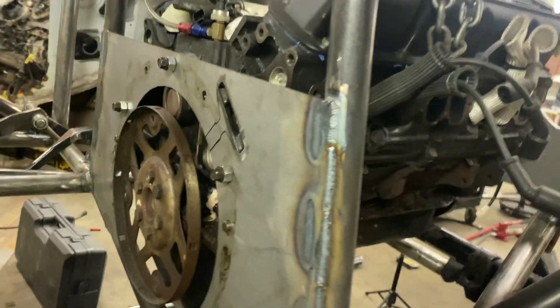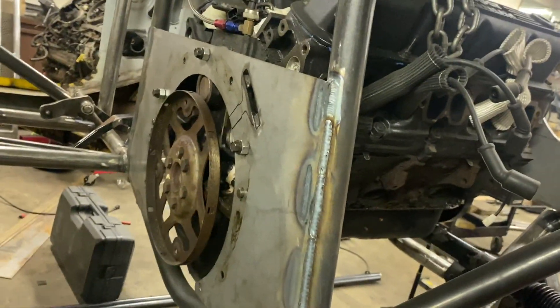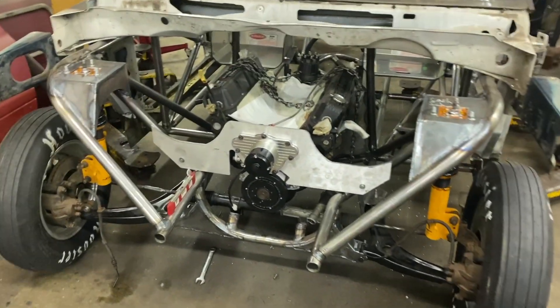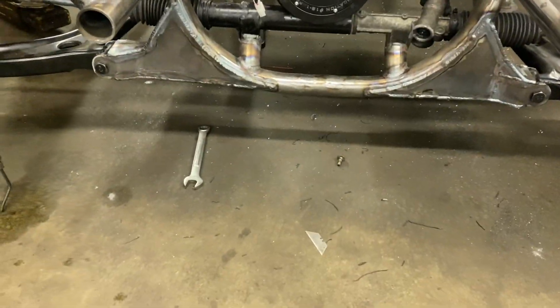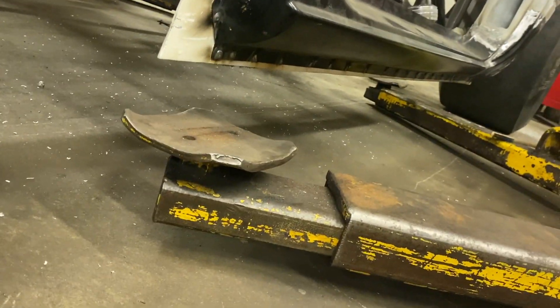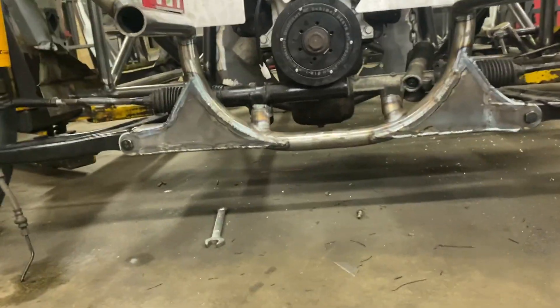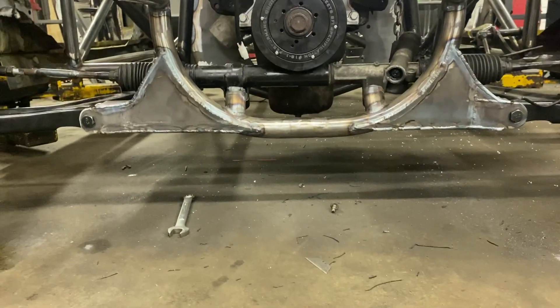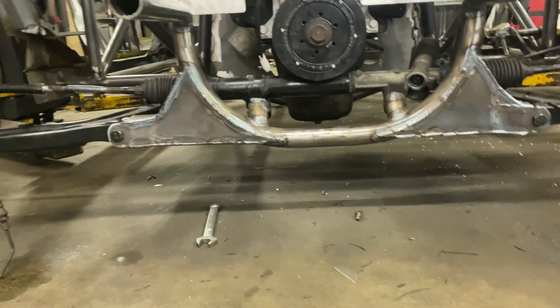You can see how the motor is sandwiched between the motor plate that's permanently attached to the truck. We also have a cutout for our crank position sensor — eventually we'll probably switch to a crank sensor off the front of the harmonic balancer. Look how low this motor sits — that's pretty close to the final ride height. Our main limitation for the rockers is actually this front crossmember, which I designed to sit lower than the oil pan on purpose so if we ever hit something, it hits the crossmember instead of the oil pan.